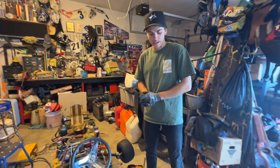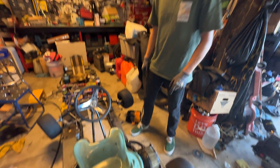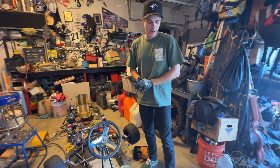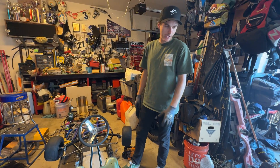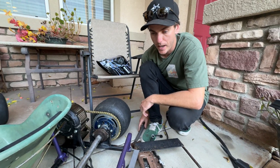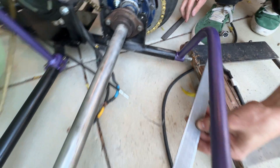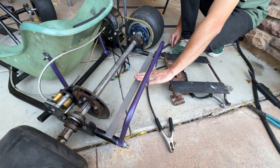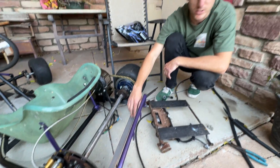It is five hours later. We have the seat installed, the motor installed, touched up some stuff, added a little paint. Next step is adding the BAC 8000 for this build, the battery, and then hooking up the throttle — she's ready to rip. Moving on to the battery tray, taking this thing down to bare metal. Got a little piece of flat steel, we're gonna weld it up right here — the battery's gonna sit on it, push up against these, and we're gonna put straps around it. It'll be solid.